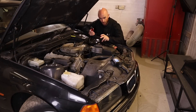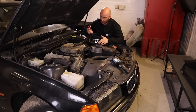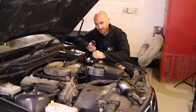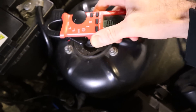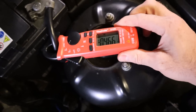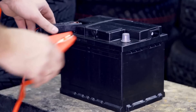I'm a sucker for old BMWs and I recently picked this one up for a personal project. When the owner got it out of their garage, I noticed they connected the battery back up before driving it out — instantly I thought there's a battery drain problem. Sure enough, with the battery left connected over a few days it completely killed it — went down to zero volts. After a quick look, we were drawing around about half an amp, 500 milliamps, so it's not going to take very long to drain that battery. I charged it back up, left the car overnight, and came back the next day to see what we could find.